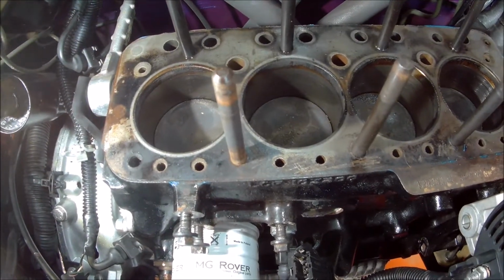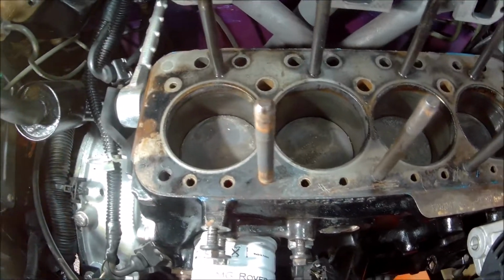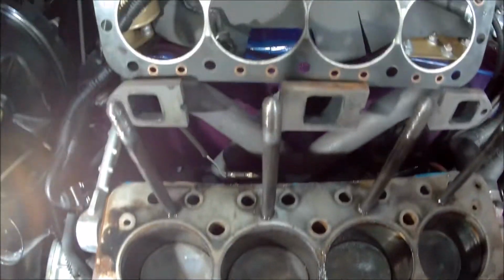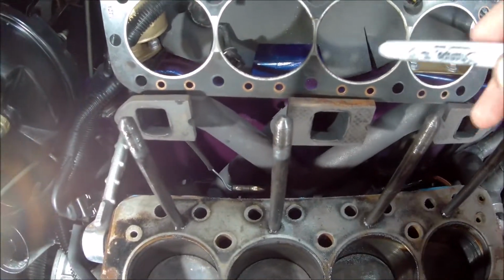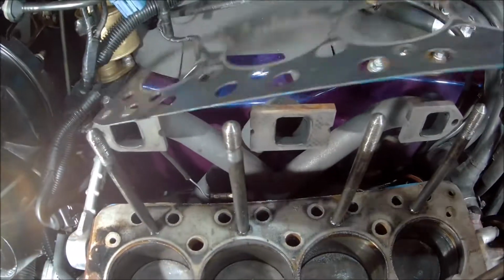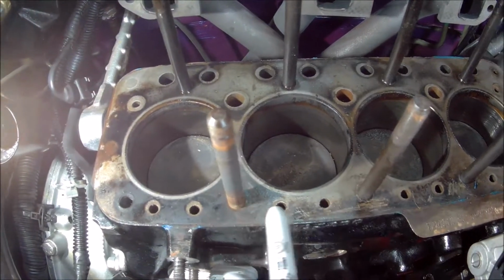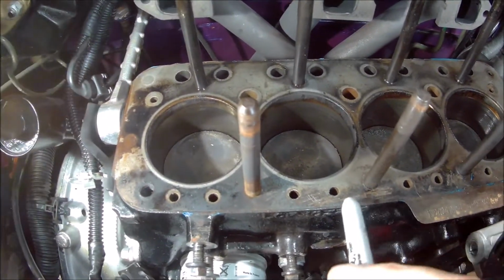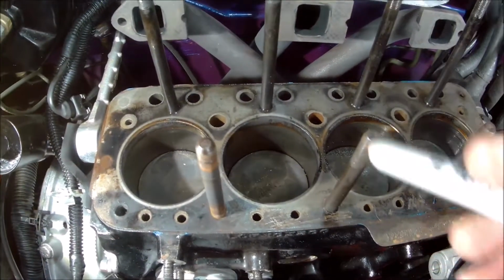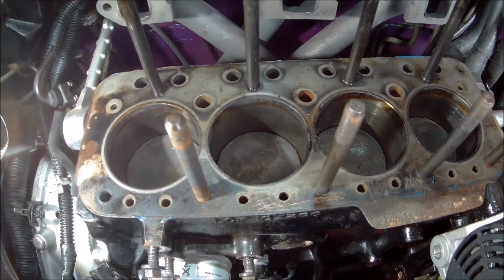Like I say, when I've taken cars apart with head gaskets gone before, it's usually a bit more obvious, you know, that you can see a split in the gasket and that sort of thing. In the case of this, I don't think the gasket itself has failed. Well, it hasn't failed. The gasket looks fine actually, on both sides. But for whatever reason, it's just not made a great seal on here. So I don't know. It was done by a professional, so you'd think maybe it wasn't torqued correctly. But hey ho, it is what it is.